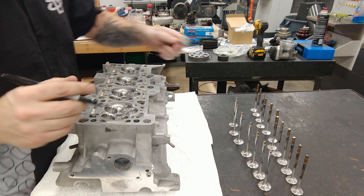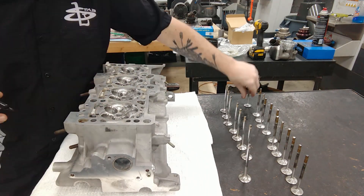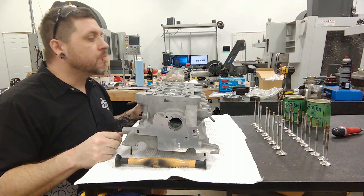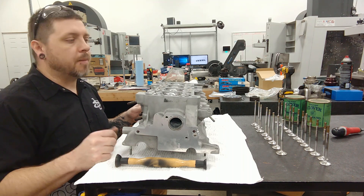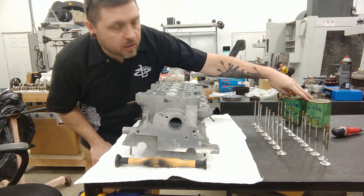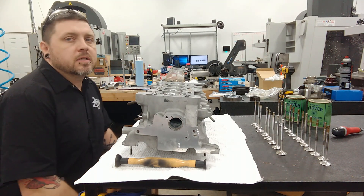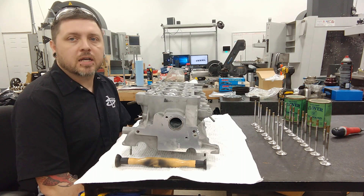And I'm going to do the same with the valves. So I got the head all clean, I got the valves all polished up. We numbered the valves, we numbered the head. So next step is to lap these suckers in. I've got a couple of compounds over here — I've got 400 grit and 220 grit. I've had these cans of lapping compound since I was like 16. I'll probably never have to buy more in my life — they'll last forever.